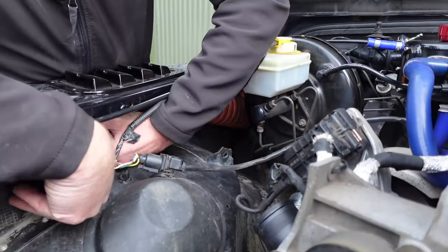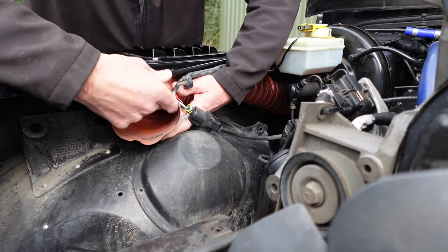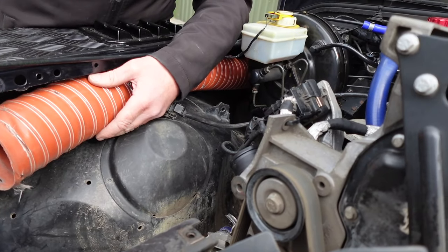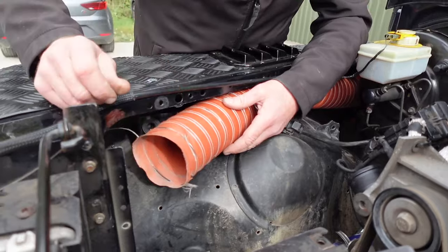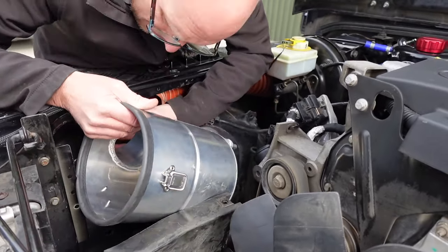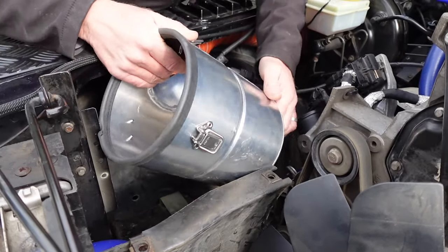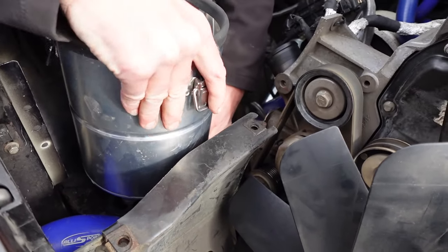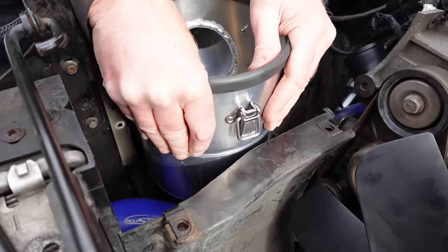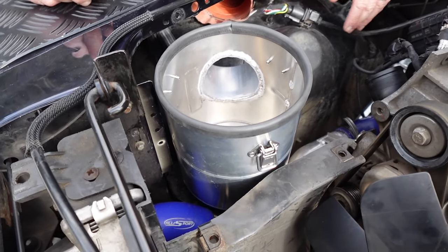And we replace that restrictive ducting with some 90mm twin wall silicon pipe, which is reinforced wire bound. So this is a simple operation of just slotting into one of the pins on the inner wing, and that rotates round and pushes down into the bracket on the chassis. So it's plug and play, isn't it? That is it. There's no modifications.